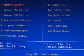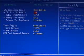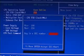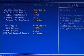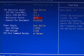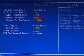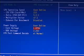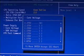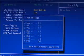Next, on to the Soft Menu 3 setup. This is my favorite place in the BIOS because you can overclock your CPU here. You can adjust the front side bus all the way up to 250 megahertz — right now I'm running the system at 213 megahertz. Also you have a few ratio options here, which are good because if you have a high front side bus it's not going to stress out the AGP and PCI bus. Right down here you have the multiplier factor which goes all the way up to 22.5 — for instance 7.5 times 213 gives you around 1,600 megahertz. Also further down here we have the CPU voltage which goes all the way up to 2.325 volts, and you can adjust the DDR memory voltage all the way up to 3.25 volts.